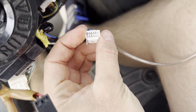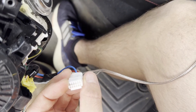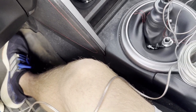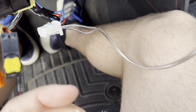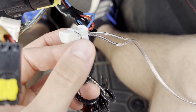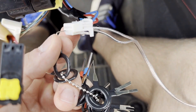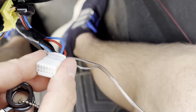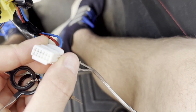There's a groove that goes up and to the right with a little slot — when this piece is down it locks the pins in. There's also a clip on the front. You can see the main pinhole and a tiny secondary hole. To get the pins out you'll need a pin picking tool. I bought these and have them linked in the description of the last video — they're on Amazon, about $20 for a big pack. You pop this piece up, stick your tool in one of these holes, push the little plastic clip a certain way, and it releases the pins.